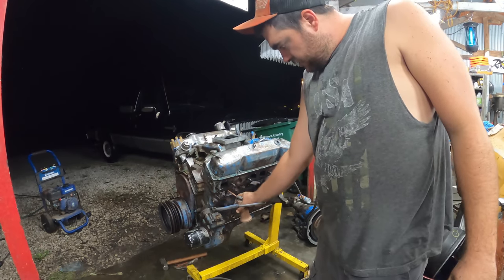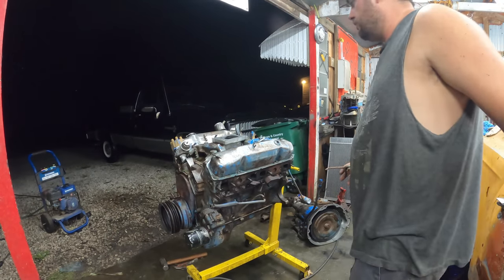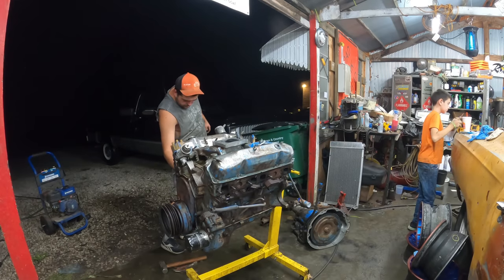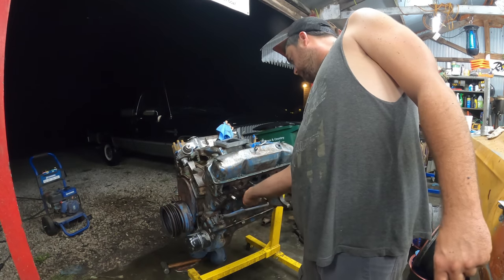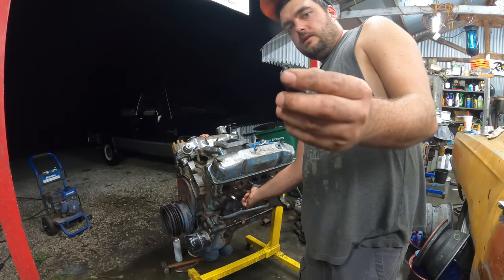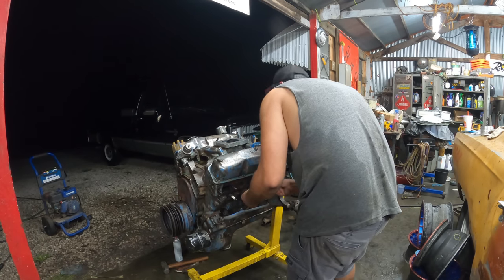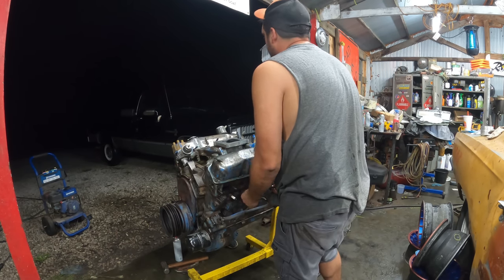Let's put a little oil in these just to be safe. We got some weird mix of ATF and two-stroke oil in here. We're going to get oil all over the engine. I'll start the plugs in by hand, seal them up for now so we can paint. These plugs need replaced anyway — they're pretty burned up. Somebody didn't gap them like at all. It's amazing this thing ran as good as it did. Just goes to show it literally doesn't matter — old engines really just don't care. As long as they got gas and oil, the rest is pretty optional.